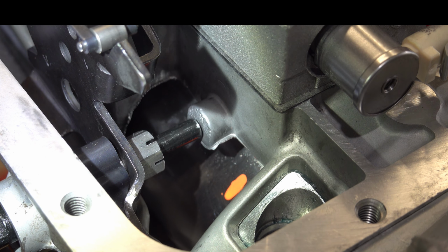So we want to take up some of that slack so that the 1-2 shift is short, smooth, or at least timed such that there's no late harsh abruptness to it. And at the same token, we want to avoid any kind of flaring on the 3-2. I guess we could say that's the premise of this video, right? We're trying to diagnose some sort of shifting issue with the band on the 1-2 transition and the 3-2 transition.